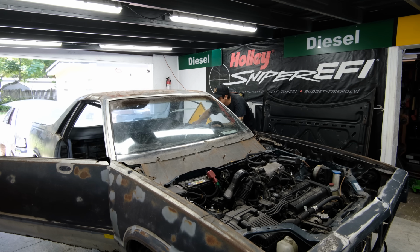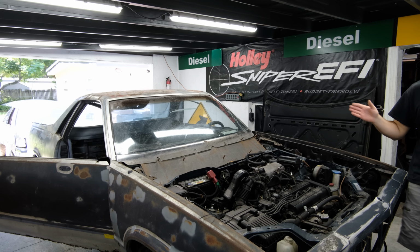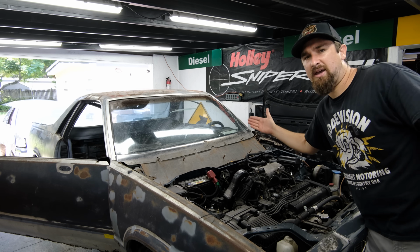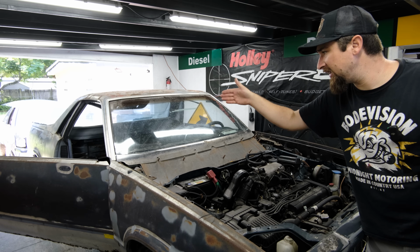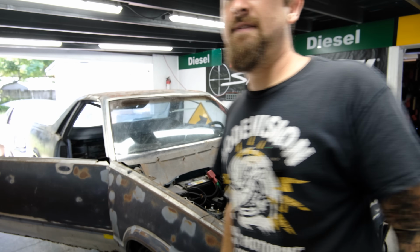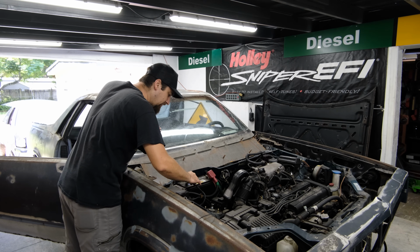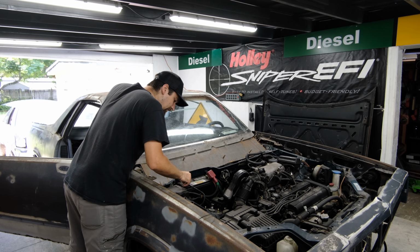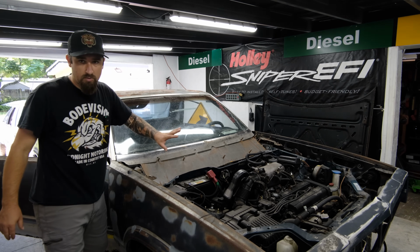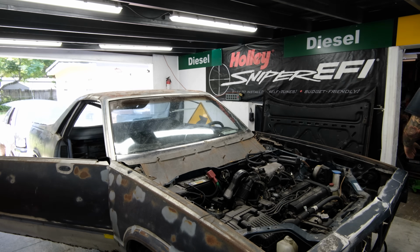And just like that, we actually got really lucky. I did all the brake lines, fuel lines, all of that stuff. Now with the wiring, it used to go in the back, hit a hard 90, and then plug in. Now we can just jog out and we can still make it. Luckily, I did not have to extend any of the wiring. So let's see if this thing is going to fire up. Let's do the quick release battery cable. We want to leave that nice and loose because I like it being quick released for right now.